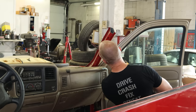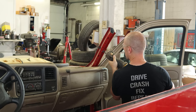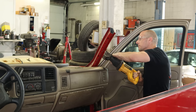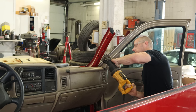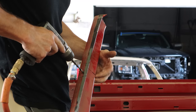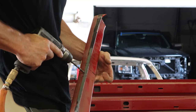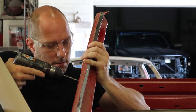Now we're going to cut our A-pillar on our passenger side, same way we did the driver's side — not necessarily in the same place, unless it happens to be a good location to join the two. There's no high strength steel in this truck, so you can pretty much put these in anywhere you want. On the newer trucks with high strength steel, this isn't possible. Now we'll drill out our spot welds that are in between our two cuts — we'll try not to drill through our hand.